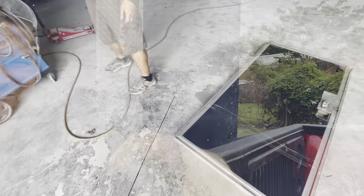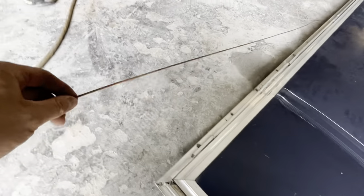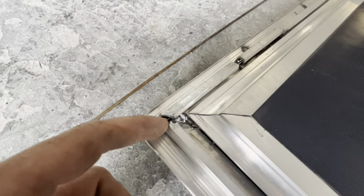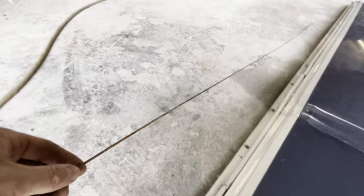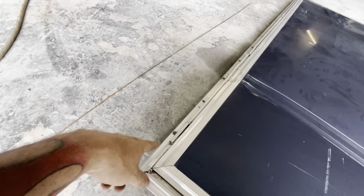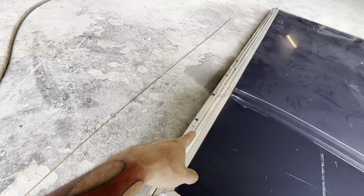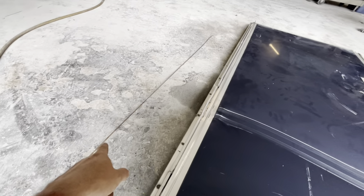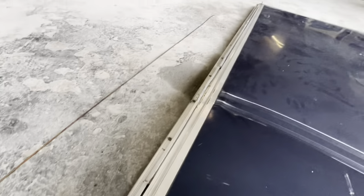Bear with the fan noise because it's 100 degrees. This little rod inside these style hinges runs down through all the sections — your whole door pivots on basically a little rod that goes through all of them. If you watched my other trailer video, I showed the issues with this style. So we're deleting this rod, getting rid of these hinges, about to cut this out and put the barrel hinges in.